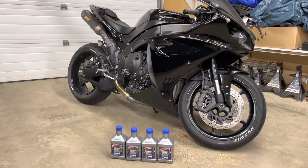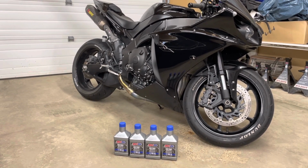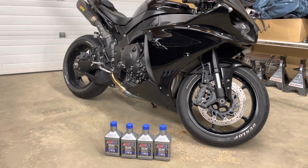And that's a wrap, guys. So you only need a 4 mil Allen key, a 17 mil wrench or socket, and 4 quarts of oil. Hopefully that gives you a rough idea what you're in for if you're about to change your oil.